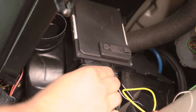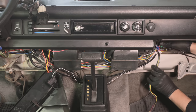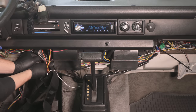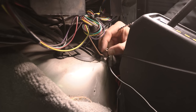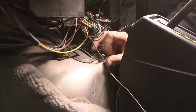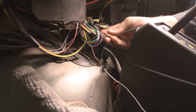Then, if you haven't already, install the wiring harness and run it over to the brake pedal, zip-tying the wires up and out of the way where necessary. The black wire with an eyelet — which may sometimes be a fork spade fitting — is the ground wire. Install this on the factory grounding lug just in front of the grommet you fed the cruise cable through. Some vans don't have this lug, so you can just ground it locally wherever fits best.